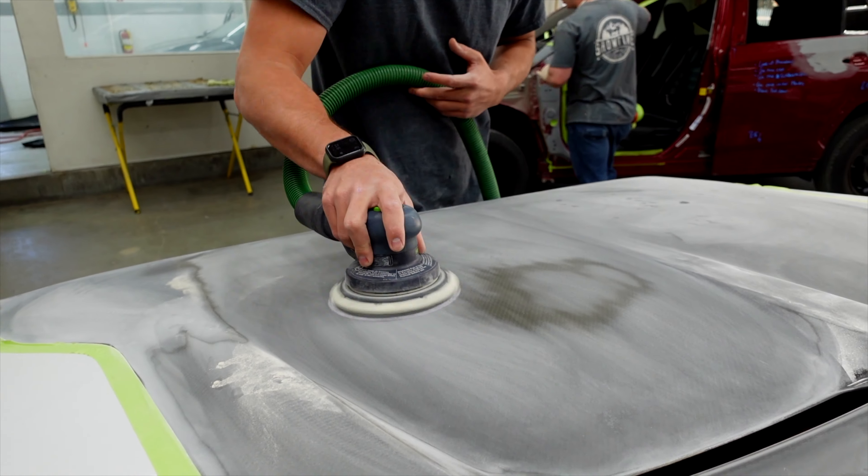We have our base coat on, we have our coverage, it's dry, and it's time to do that fine line peel and reveal the line between the carbon fiber and the fresh white base coat. It's very important when you're pulling this tape that you do it in a specific way. If you pull the tape up, you're not going to get as clean of a line. You want to do what's called a hard pull — pull it at the sharpest angle you can, basically directly backwards. Pull it hard directly back just like this — don't pull up, make sure you're pulling directly back.